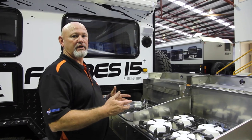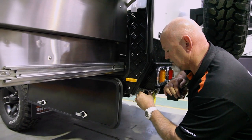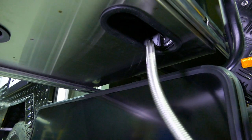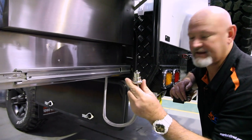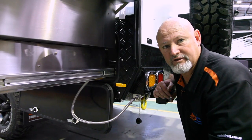Now that we have this open, we're ready to hook up the gas. Get around here — the gas knob, push it in slightly, turn it one way. The gas line is underneath here. Find the end of it and pull it out. With your gas fitting, place it in — it can only turn one way. Push it in and turn to the right. You're hooked up for your gas. Now go to the bottle at the front and actually turn the gas on.